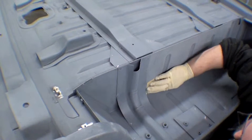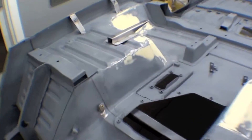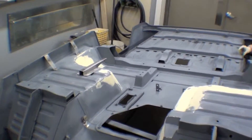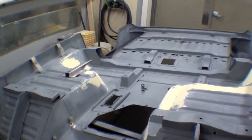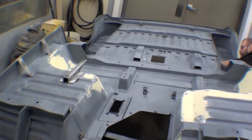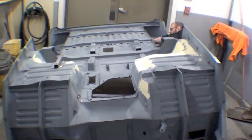We have it all in primer here. We're going to shoot another round of epoxy primer in order to get our brackets and our bodywork covered, and then we'll go right into some paint color — that'll be pretty nice to see. Nice bright free born red, factory red color, so it's nice to see the work being done and soon we're off to primer and paint.